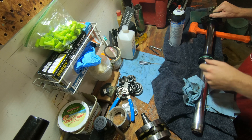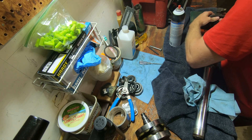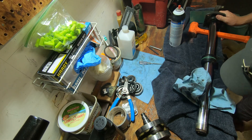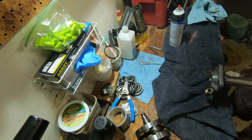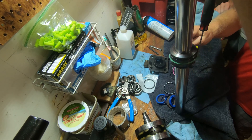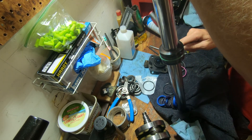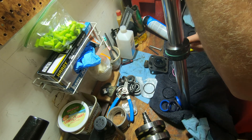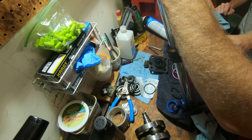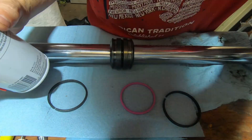The rest of the job can be completed on the bench — it doesn't need to be done on the machine. First you want to pop off that end cap. You should mark the end cap and which side it came off because the two sides are not the same. We started with the middle seal and it was a bit of a pain — we used a mini screwdriver and a pick and then it just broke off. So maybe save some time and just cut it off.